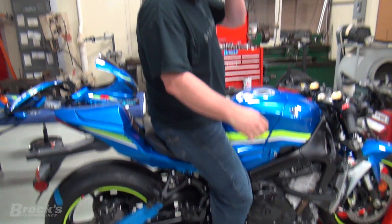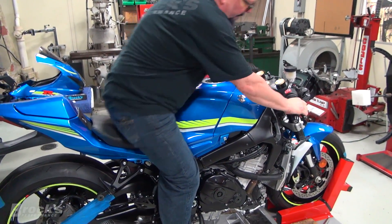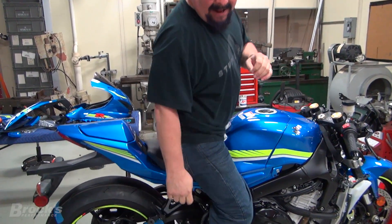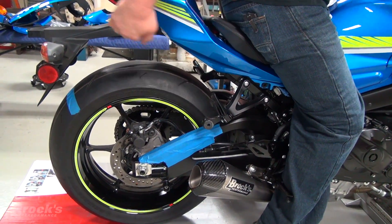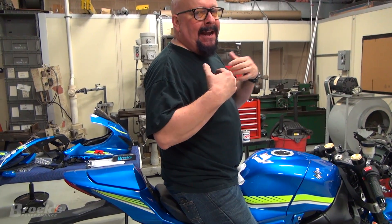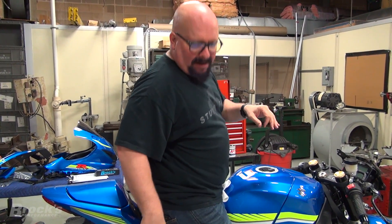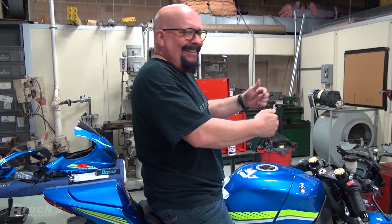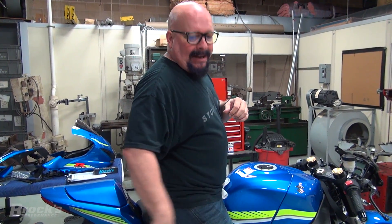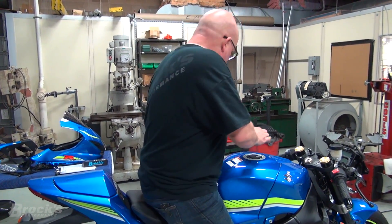Check it out - I went from tippy-toed to flat-footed. That's pretty nice. Lower the strap. It looks like I've got plenty of travel right now, even though it's close at the shock. Even with me at 210 pounds, the rider we have lined up for this is 190 pounds, and we'll put a lighter guy on. He wouldn't be compressing the suspension going down the track nearly as much as I would, and the same with the weight transfer. If I launch this bike, I'm going to put more stress on this particular area than a lighter guy. Right now, that's pretty good.